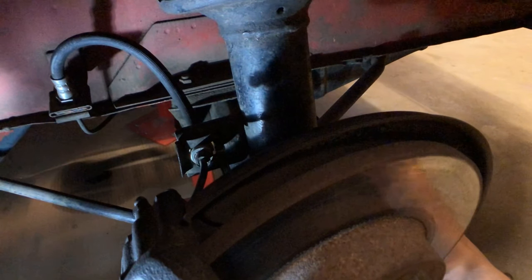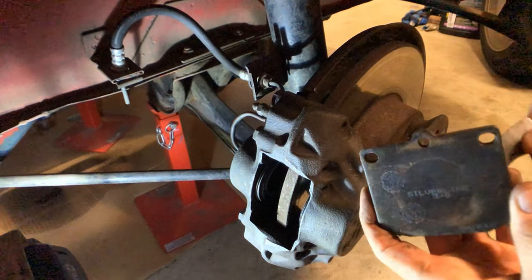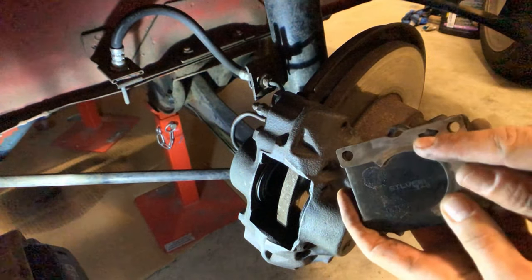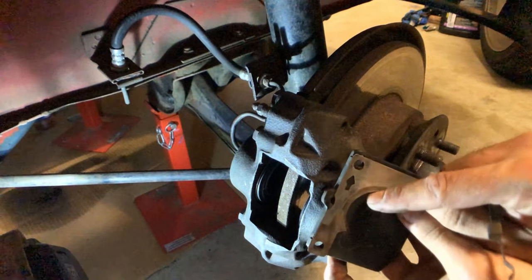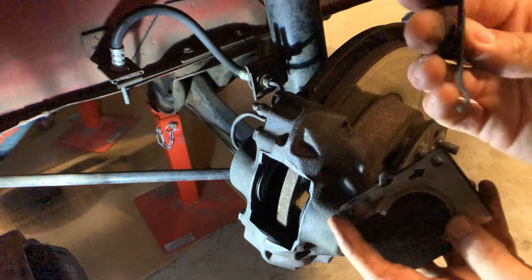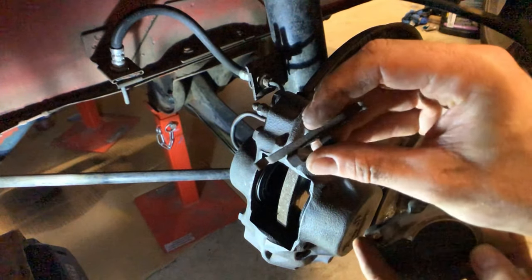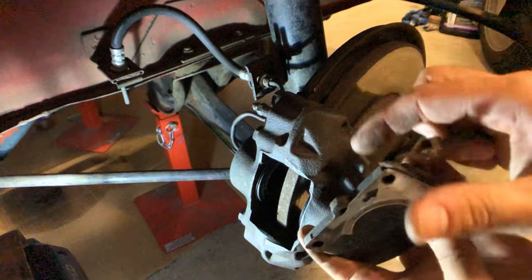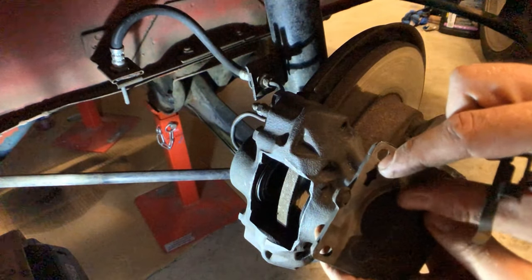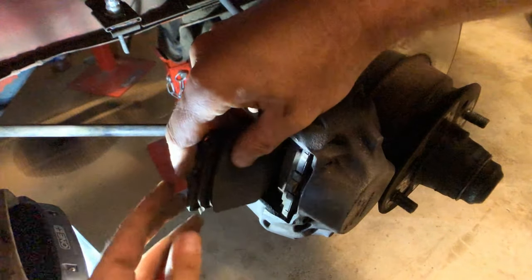The rest is now just inserting some brake pads. With the brake pads you have two accessories to attach to them. One is an anti-squeal shim — this arrow points towards the bleeder screw for the install. And we've got this retaining clip that goes in on top. This retaining clip is important because it helps hold the brake pads down against the pins so they don't rattle. So these are important to get on.